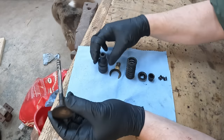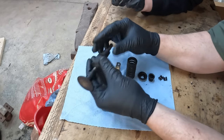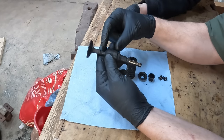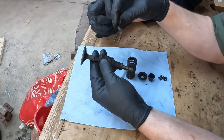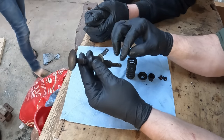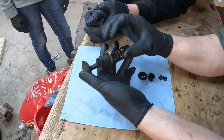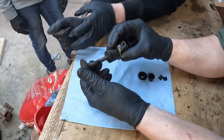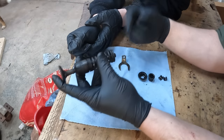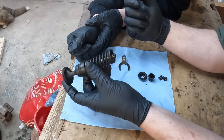Valve goes through the block this way. In the block is the valve guide. So it goes in here like this. And then below the block, which let's just picture there's an imaginary cast piece of metal right here, Caitlin. Right below the block goes this retaining clip, just like that. Now this is what I thought we would be able to actually grab here through the spring, because the spring goes over this. Grab that and pull down and pull the valve guide out of the block, at which point you can pull the retaining clip and the whole assembly actually can come out of the hole. Our valve guides are all proving to be pretty sticky. They've just been in there for 60 years probably.